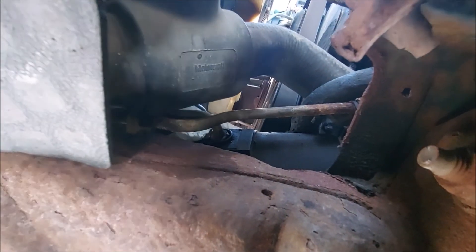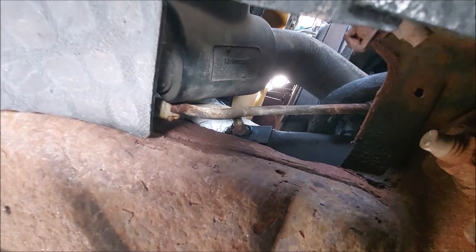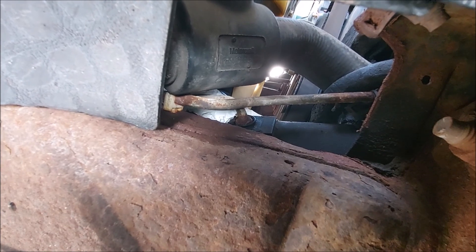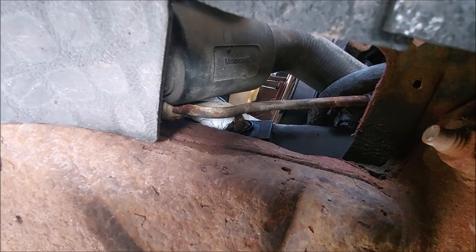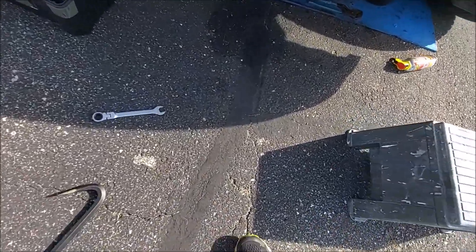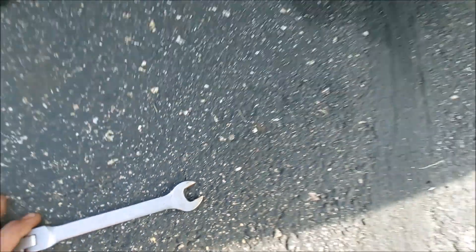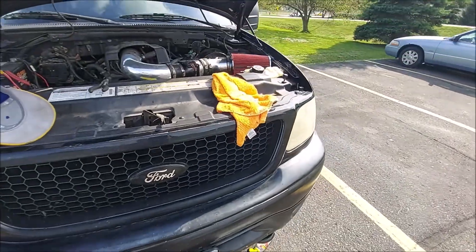See where I have the glove in the hole right now? It's right behind — not that one that's fitted in there, it's the one behind it. Some people get at it from this way. I used an open-ended 16. You could use a pipe cutter and cut that, then get a nut over it. But I was able to break it free. It was a 16 open-ended. I was told a 14 on things I was watching online, but that 16 took me a little while to get out.